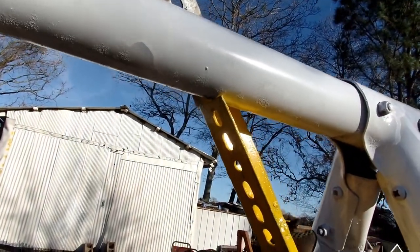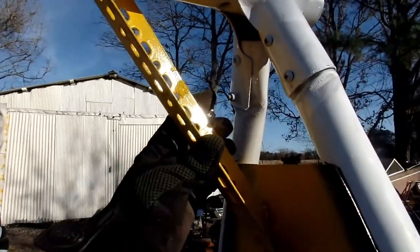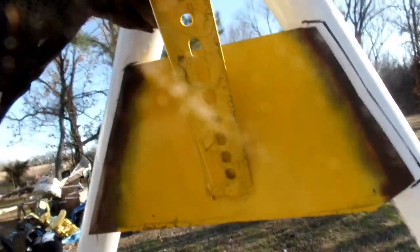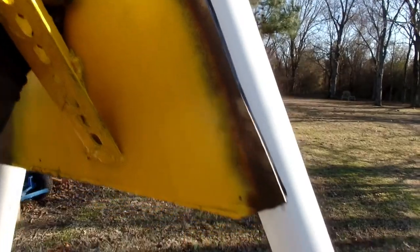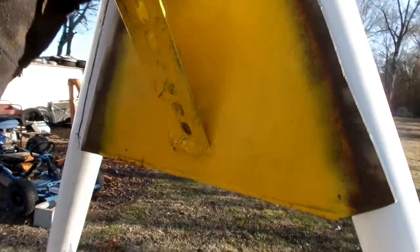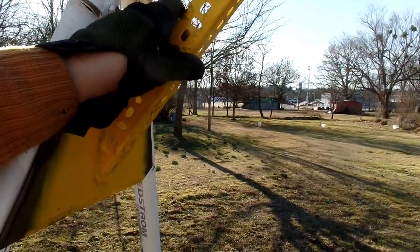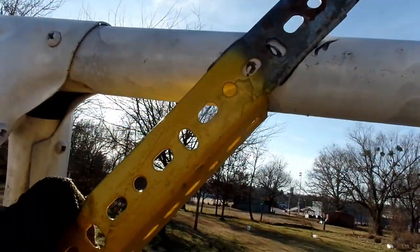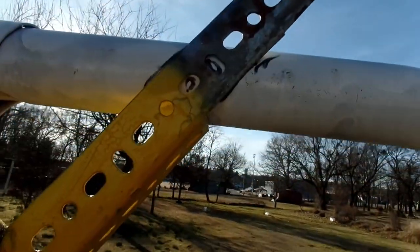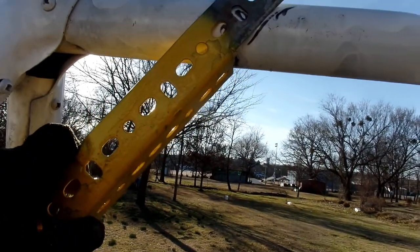I've got that bottom piece braced up against it and I'm away from the crimp. You can see the marks I drew out. What I'll do is put welding clamps to hold this in place, start doing spot welding down through there after I buff all the paint off and ground my electrode well. You can see where those holes are in this piece — I'm going to weld around in those, which is called rosette welding. Wrapping that piece around that tubing is going to give me lots of good welding areas and brace this up real good.